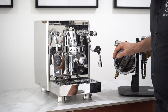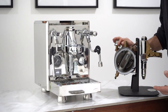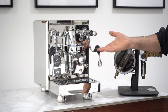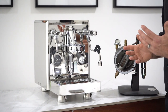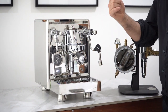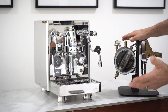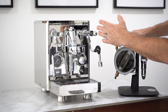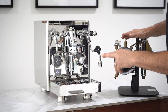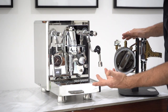What we have here is a heat exchange machine. With a heat exchange machine you've got a designated brew chamber, which means you can basically brew, steam, and do everything at the same time. With a single boiler it's one extraction then you're flicking over, boiler comes back to steam pressure, and there's about a two-minute downtime. With a dual boiler and PID you can ramp up steam pressure and control brew temperature. With a heat exchange, you're using the temperature of the steam and balancing the brew temperature — if you put that steam pressure too high you will get a splattering effect.